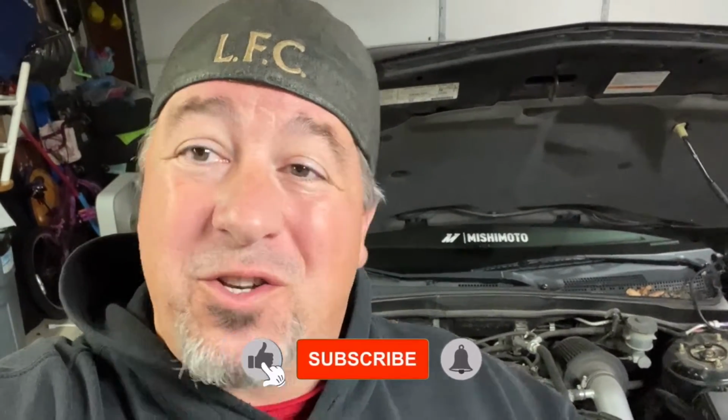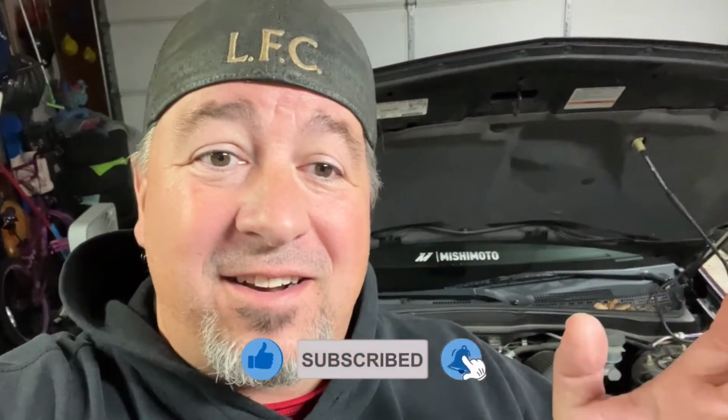Today we've got the RSX. It is not starting and it's not a battery issue. It's obviously a starter issue. There's no click. It's nothing. It's either ignition or the starter. We've basically boiled it down to it's a bad starter. So battery's been tested and everything. That's the next step. The issue is actually getting to the starter in this car.